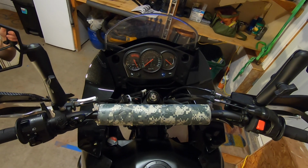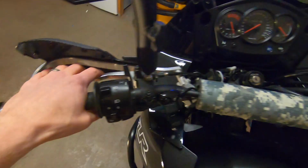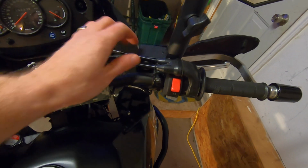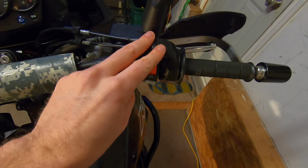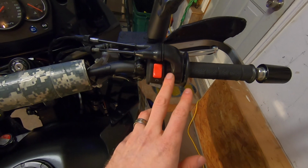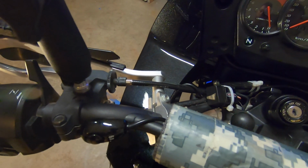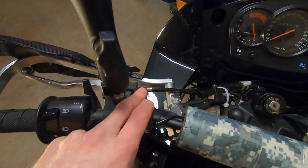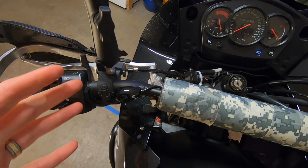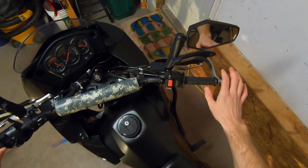Specifically what we're interested in doing here is working with the throttle cables and the clutch. There are 3 cables overall that we need to worry about. There are 2 for the throttle. They have their own housing that's covered by this little rubber shroud. So we'll need to remove that and open up that housing. For the clutch, it's a little bit simpler. We just have the clutch connected there, so we just need to loosen it here and then loosen it down by the engine side, and that'll give us enough slack to remove that cable so we can get the cable lube tool in.